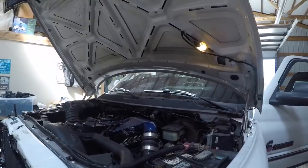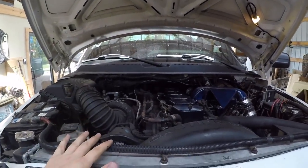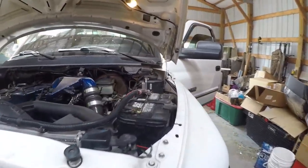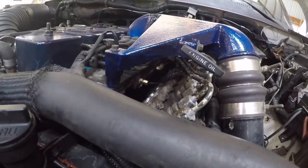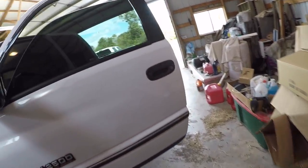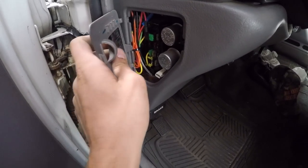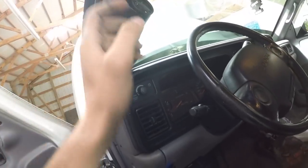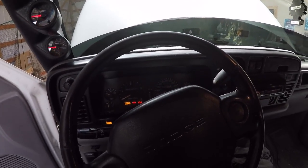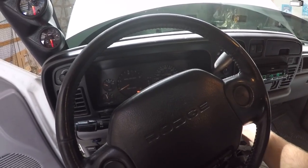Good morning loud and proud fam, another beautiful day in Indiana. We're out here with the truck — I just finished wiring up. Got anti-seize on the EGT probe, got it ran up into the cab. The boost fitting should all be good, the trans one is already done. Everything is wired up at the fuse panel, all wires zip-tied together. I already tested it — they come on with the turn of the key. This is going to be the first startup with the gauges.